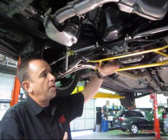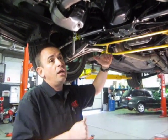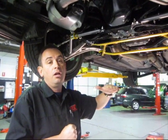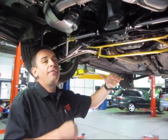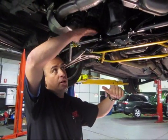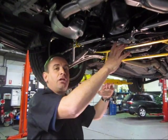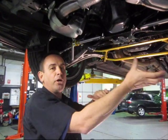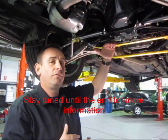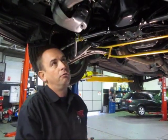On a Subaru or Evo, the roll centre is somewhere around here, but on some models like the Evo 9 and Evo 10 when lowered, the roll centre is actually mechanically below ground level. The distance between the roll centre and the centre of gravity — which sits higher due to the engine mass — is the mechanical advantage over which the car body rolls. Move the roll centre up closer to the centre of gravity and you reduce body roll, hence the advantage of the roll centre kit.